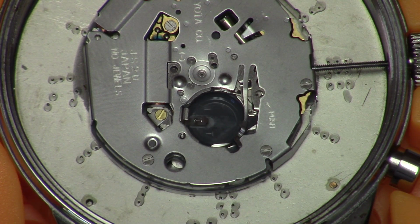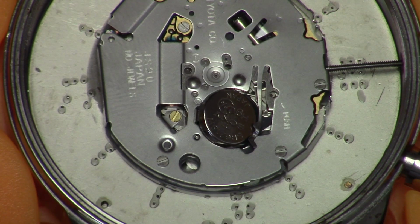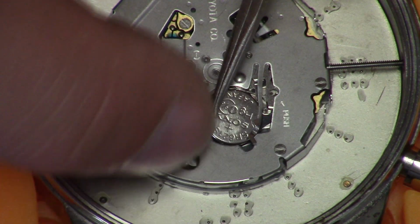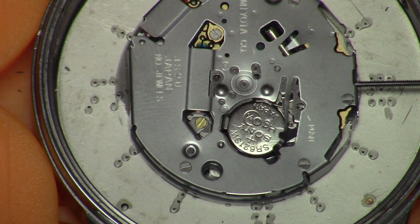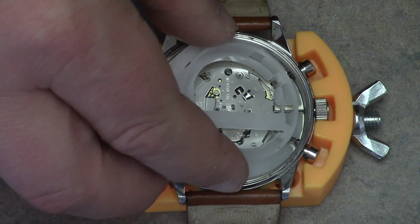We take out our new battery and insert the side under the pin. We use our tweezers with a little side pressure to push the pin with the battery and slip the battery underneath the fixed metal clip. We then replace the plastic piece we removed earlier.